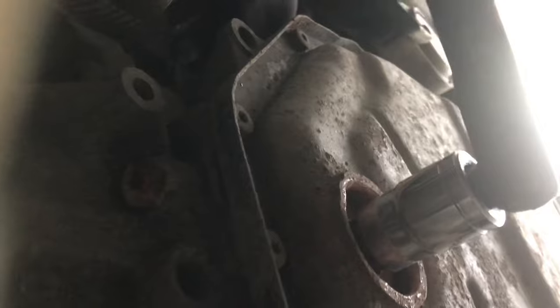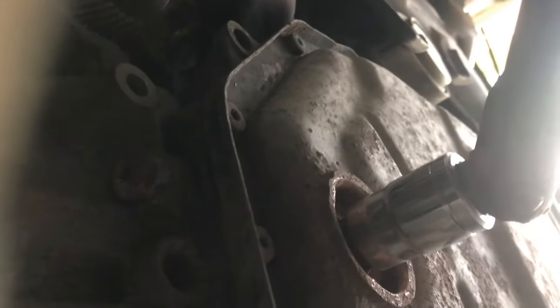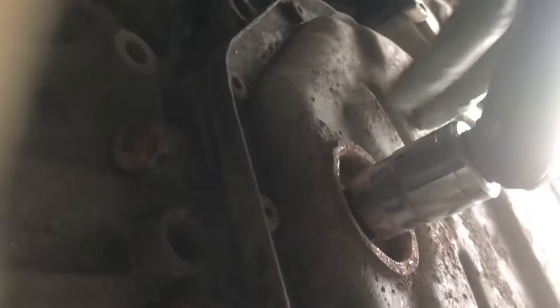Got this broken loose, and let's loosen it up a little bit, but don't take this out while it's still cold. If you take this bolt out while it's still cold, there's still going to be excess fluid in the bottom of the pan, and some of it's going to drain out.